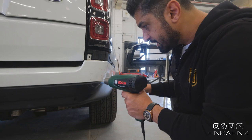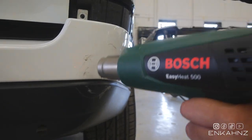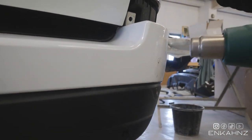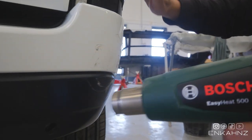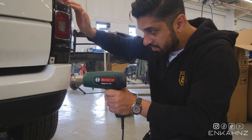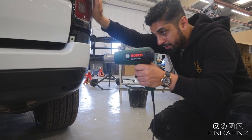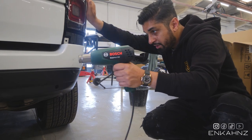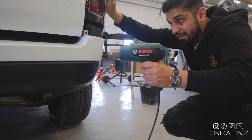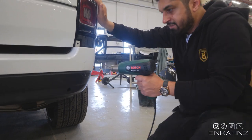As you can see, it's slowly coming back to its original shape. If you look at it from an angle, you can see it returning to its original form - all by using this heat gun. Remember, do not hold it at any one point directly on the bumper because it will deform the plastic, cause a burn, and definitely damage the paintwork.